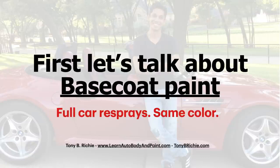First, let's talk about base coat paint. Okay, now we're talking about 2K paint jobs, two-stage paint jobs, another word for it, where you're laying your base coat, which is your color, and then you are laying your clear coat on it. And there's also something called three-stage paint jobs, where you lay your base coat and then you lay your mid coat, which is like a pearl or a flake coat. You know, that's going to take a little bit longer. Of course, you're going to have to consider that paint as well in the mid coat. But here we're just talking about basic base coat application and then a clear coat on top of it.